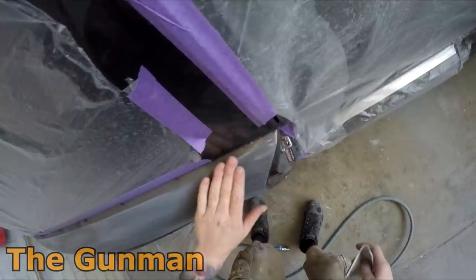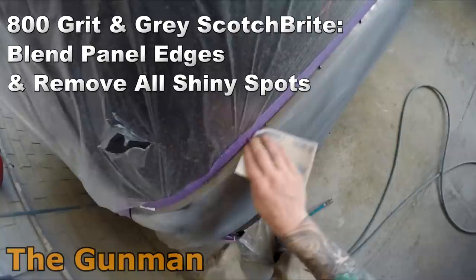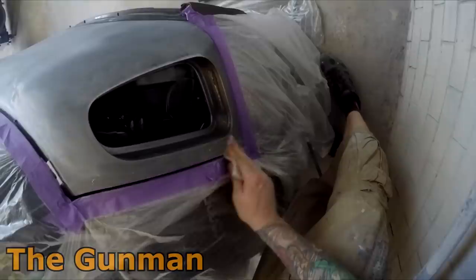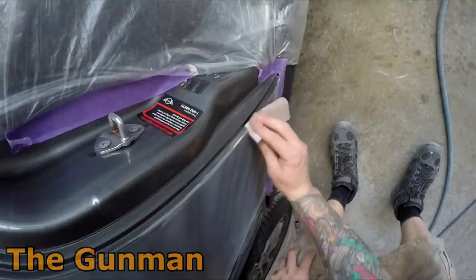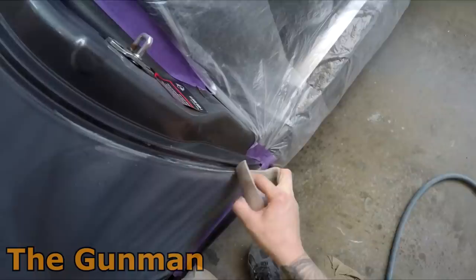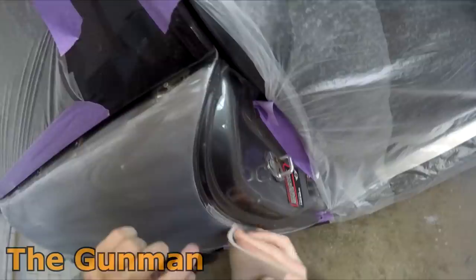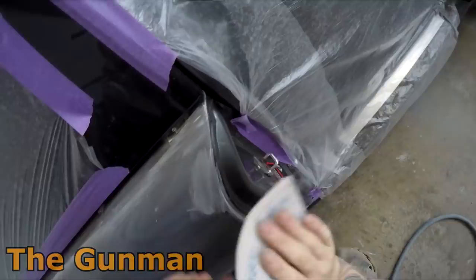I'm not here to tell you how to do your job — I'm just showing how I do it. What I'm doing now is going over the edges quickly with a piece of 800-grit soft-back sanding sponge. I love these things — they cut out the orange peel and take that top layer of clear coat off. Then I'll go around the rest of the shiny spots with a gray scotch-bright pad. About a year and a half ago I never used scotch bright at all, but now I knock the orange peel out with the 800 pad and use scotch bright on the really tricky edges.